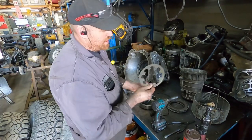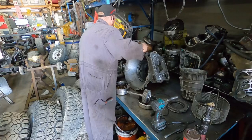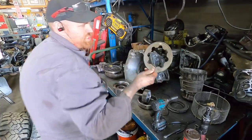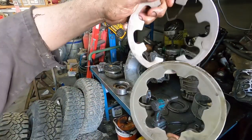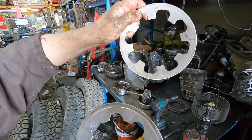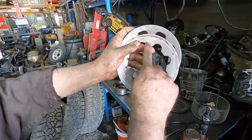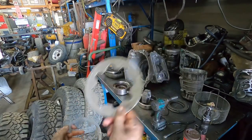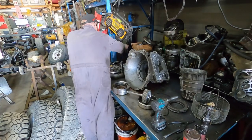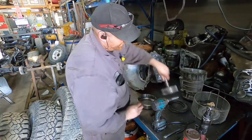And then this, the apply piston, is actually the wrong apply piston for this. This is the apply piston that you want to use. So this is a 47 apply piston, and I believe that the 727 used the same one. We'll actually find out, because I'm going to rip a 727 apart for some scavenged parts. And then this is the one that you want to use, so you can see the finger difference. So these are apparently a lot better. So put that back, just so that I've got all this stuff in the right spot.